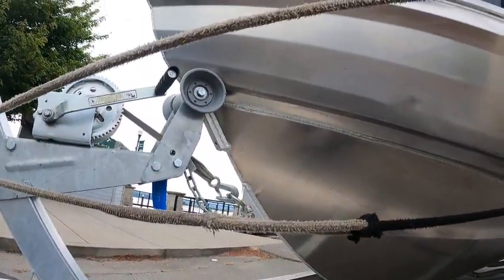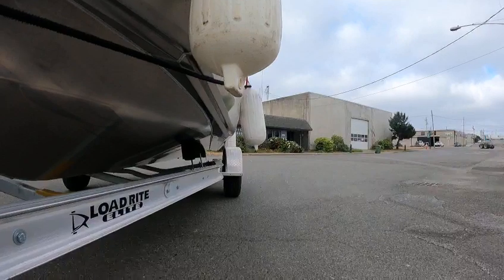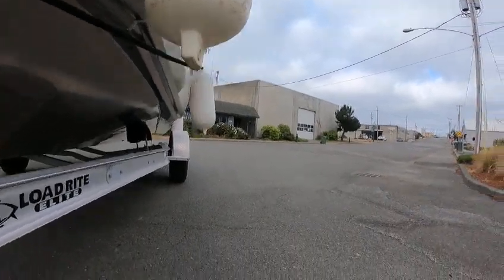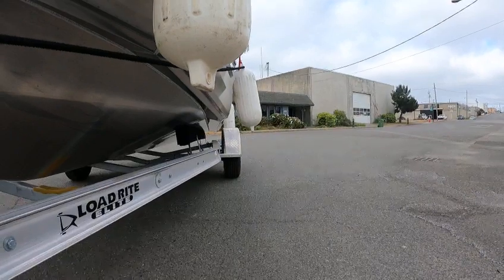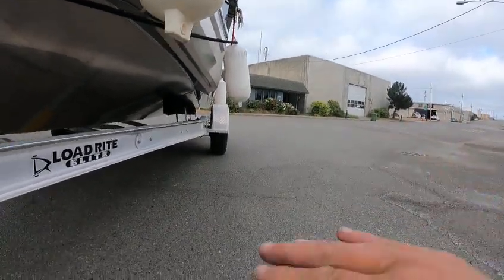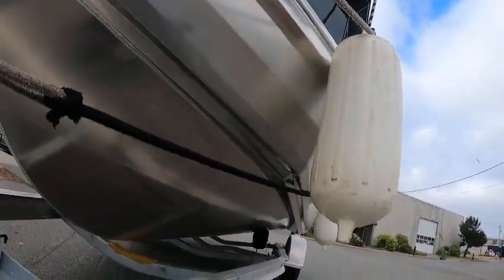They made that a lockable style so you can just drive your trailer up. That flare there — they call it G3 tubing. You got a little reverse there and there, and then it transitions back. See how that flares at an angle down — that keeps the water spraying down and out. All the way back it's a real big hook, not flat and straight out. That's where the difference is in how tight these things turn, because a lot of reverse chines just come straight — this one actually angles down, so it grips and acts as an air pocket coming down.